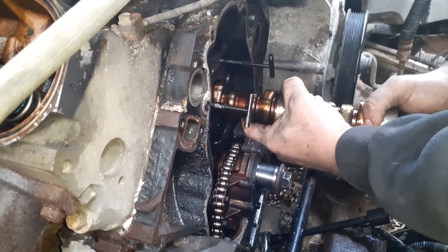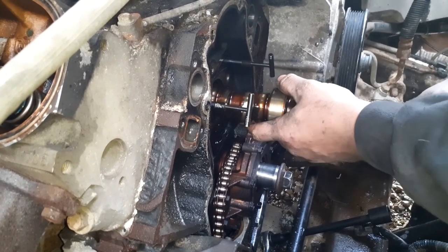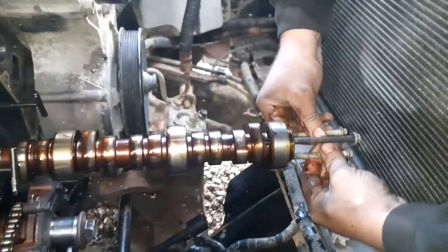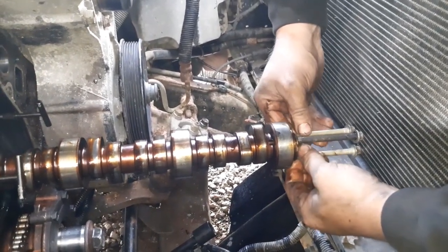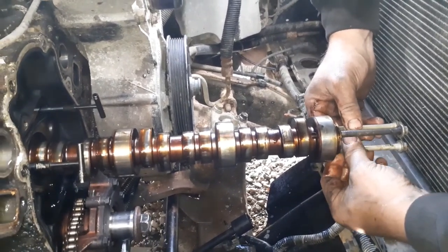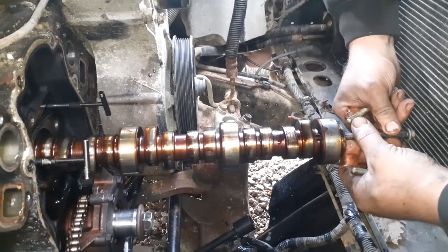It gets easier the further you come out. You don't really got to do a full motion - you can go back and forth. Now once you get so far, you've got to take your water pump bolts out of the front of the cam. We should have already had the other cam ready and lubed up to stab. Oh, this is loose right here - kids throwing rocks, buddy, hit the truck. Don't do that.